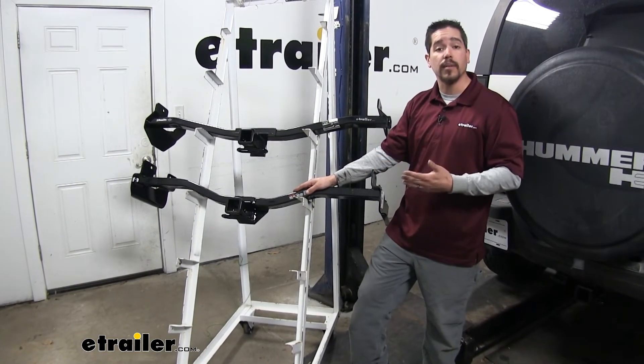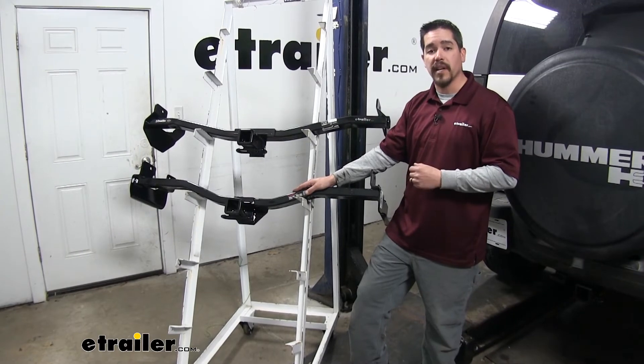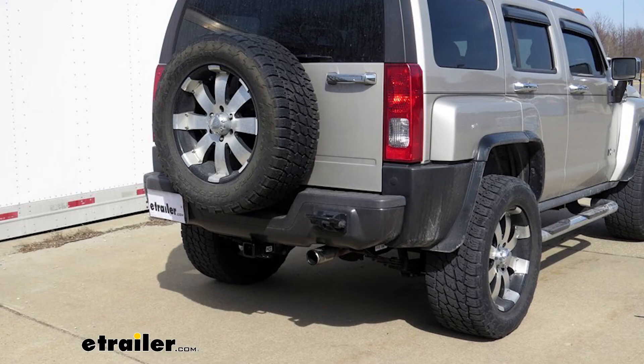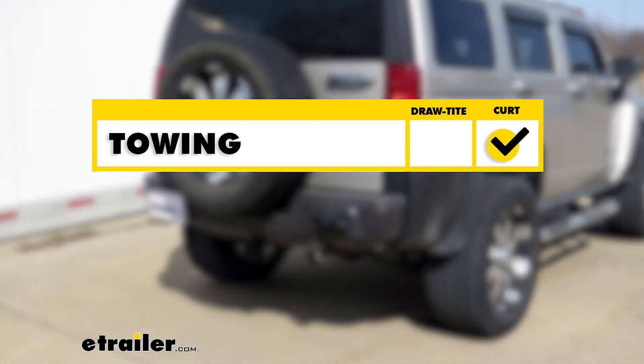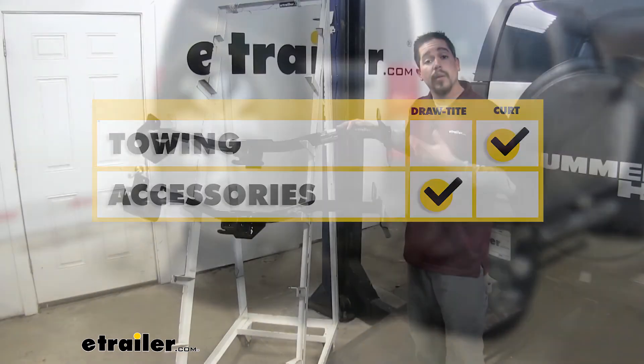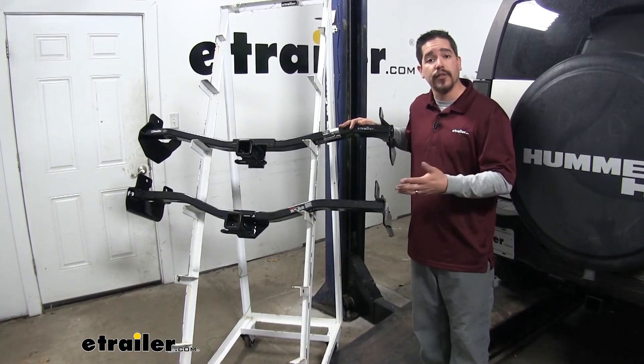With all those numbers in mind, you want to double-check your H3's owner's manual, because you don't want to exceed the manufacturer's recommended weight. To sum everything up: if you're looking for a hitch purely to tow, I would definitely go with the Curt because it has that increased weight rating with weight distribution. If you're looking for a hitch to mount a bike rack or cargo carrier, I would go with the Draw-Tite — it has the built-in anti-rattle with the option of the J-pin stabilization device, and the receiver tube sticks out about an inch farther, giving more clearance with our spare tire on the back. We hope this information has helped you whenever you're looking for a hitch for your Hummer H3.